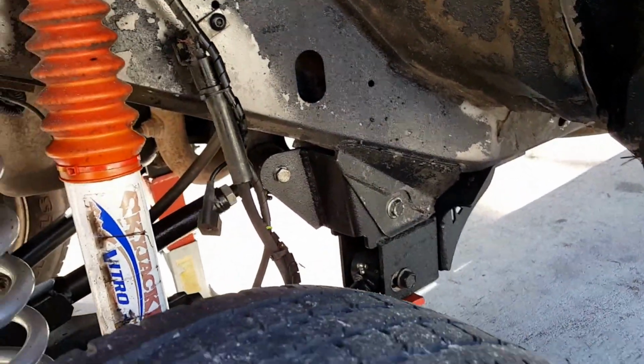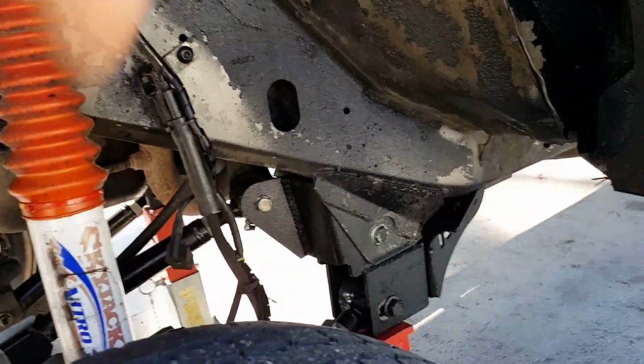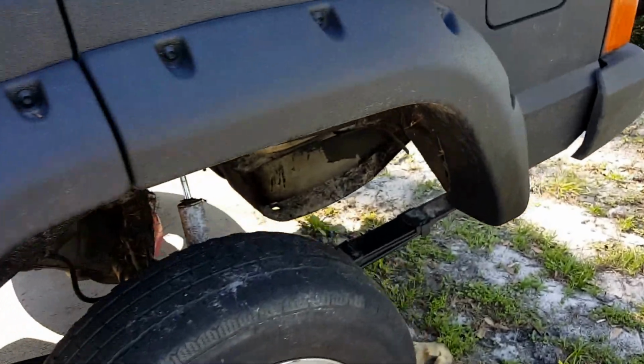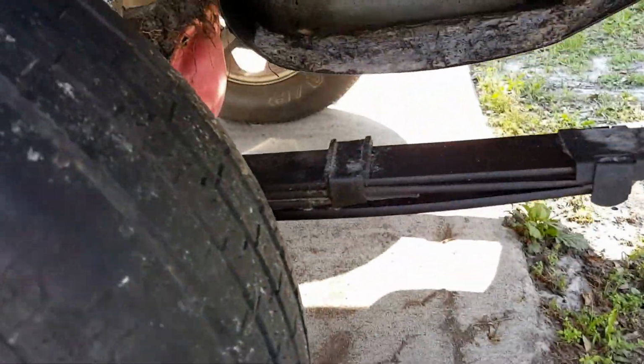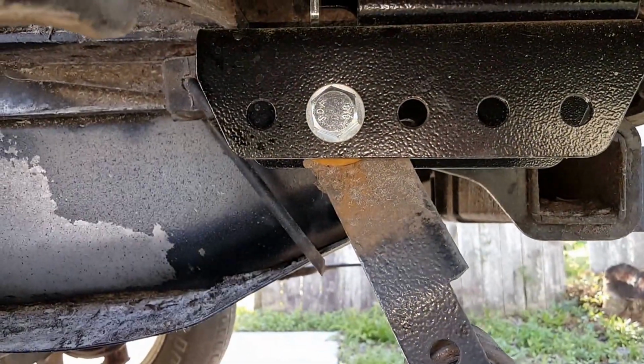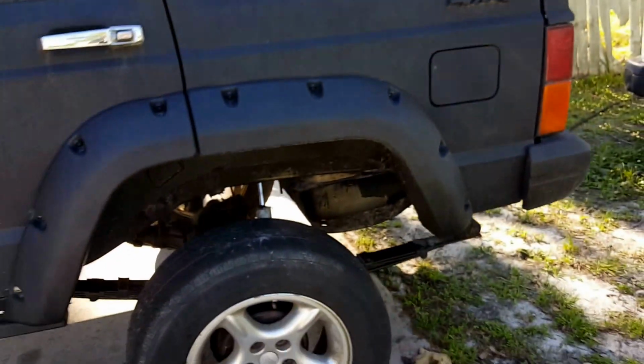When you flex this thing out on a ramp, it'll lay that tire on its side with this on there. I ran it on my Jeep for a long time. These are made by Rough Country. And it's got 6.5 springs on the front, and she's got a helper set up on the back. Those old 4.5-inch things, what it was, with the shackle relocators. These shackle relocators will give you real world 2 inches, about right at 2 inches of lift.